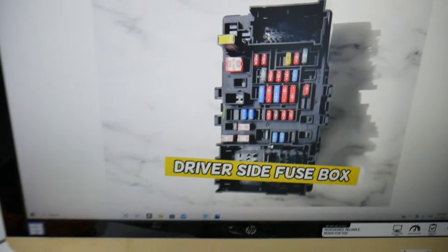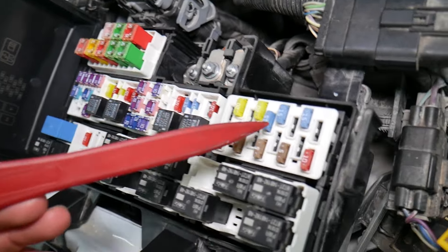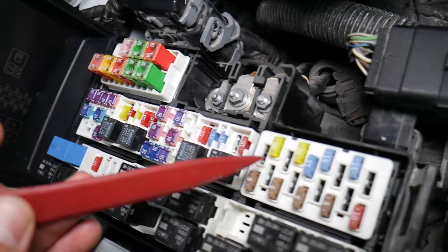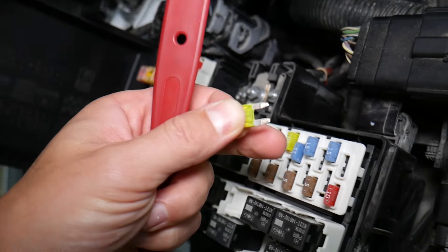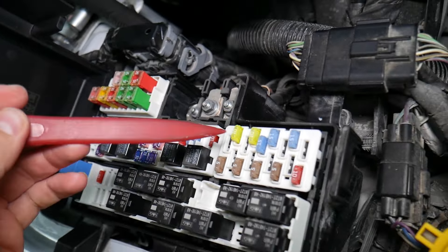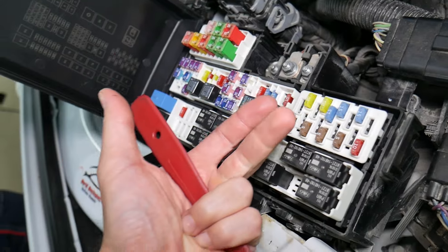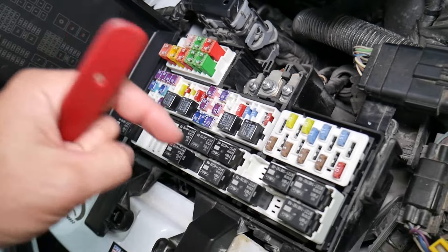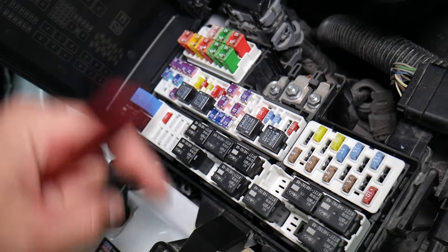Before we continue, let's explain quickly why it's always a good idea to test fuses and relays. It's very important to test them because on those fuses, you cannot clearly see if they're burnt or not — especially on JK-style fuses. If you remove a fuse, look at it, and assume it's a good fuse, it may actually be a bad fuse that you just can't see is blown. What can easily happen then is you put the bad fuse back in and start replacing parts you don't need to. You lose your time and money fixing a problem that doesn't exist, when all you have to do is test and replace the fuse. We'll put a link to a special video in the description that will teach you how to test fuses and check relays very easily.